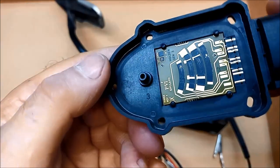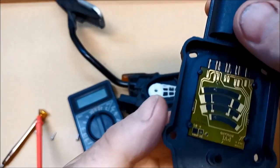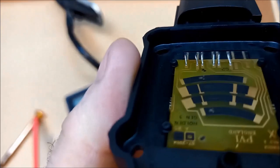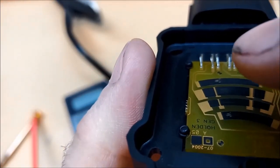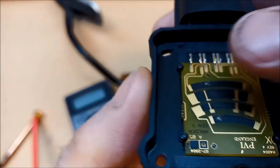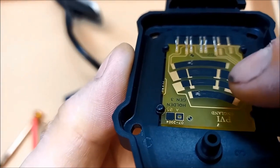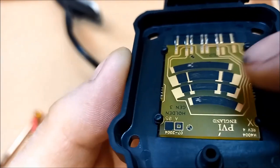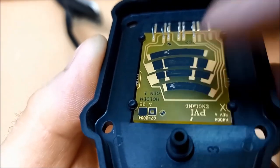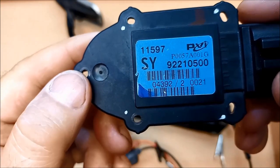Definitely if they had a bit of grease in there it would have lasted a lot longer. You can see it's got those six points — one, two, three, four, five, six — so only six out of all those eight points are working, and you can see the different positions it gets the three different readings from. If you didn't use this accelerator much it would probably operate all right, but anything over quarter throttle it goes into limp mode. Don't forget to like and subscribe — thank you for watching.